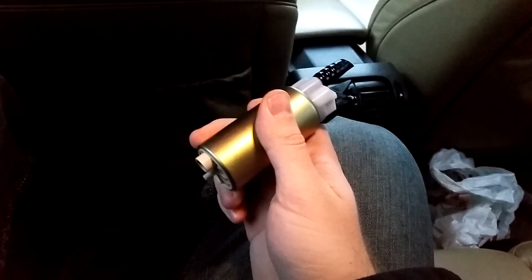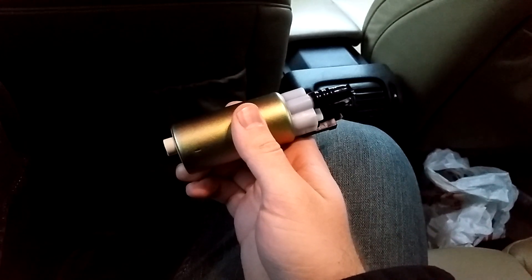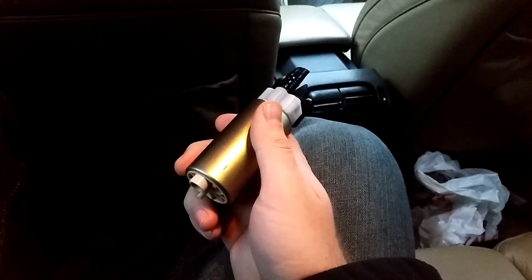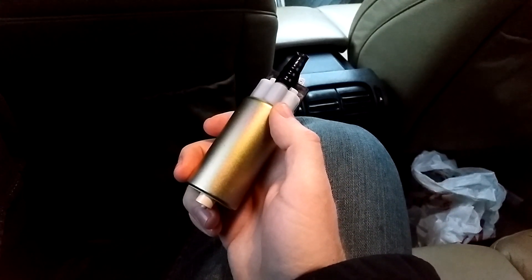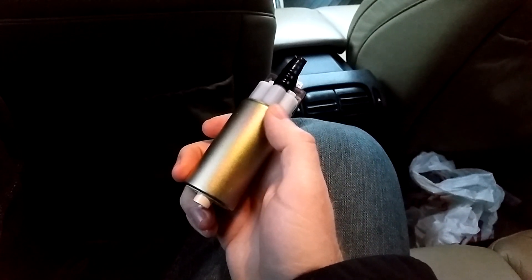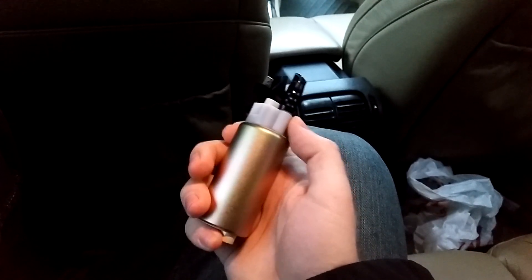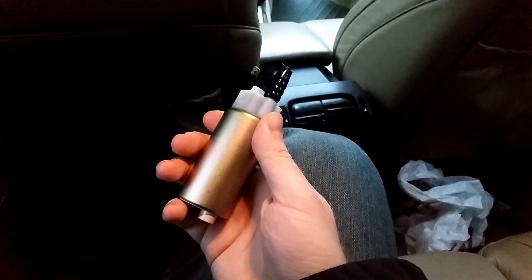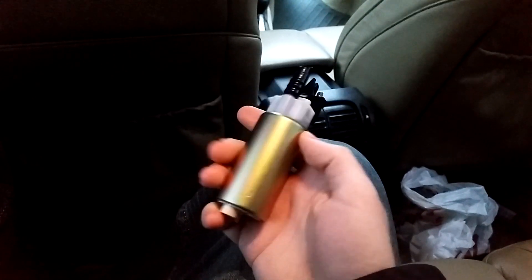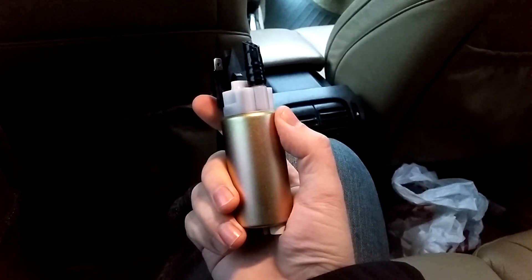It's been a few weeks now and the fuel pump is working fine. I've been driving the car for maybe 1,000 to 2,000 kilometers with no issues. A reader at my project thread on the Swedish Saab Turbo Club forum suggested the old pump failed because the previous owner had switched to an aftermarket pump rather than a stock pump, back in 2012. I did some digging and found the old receipts, and confirmed with the workshop — yes, it was an aftermarket pump. This is why it failed almost right away when I started filling up with E85. If it had been an original pump, I would have expected it to run for quite a while on E85 before giving trouble.